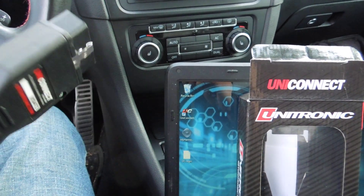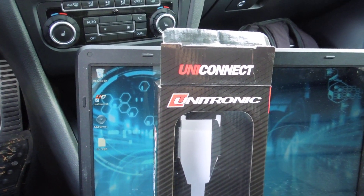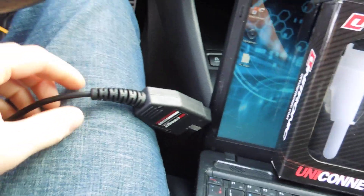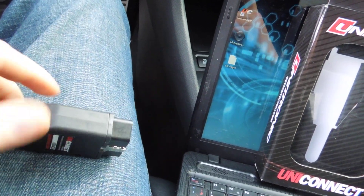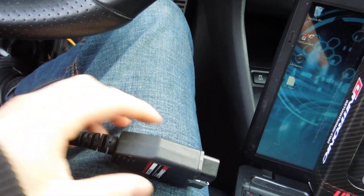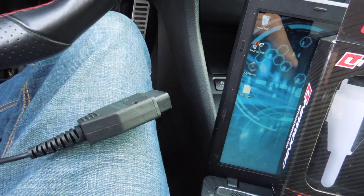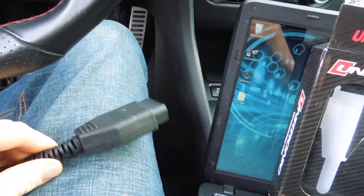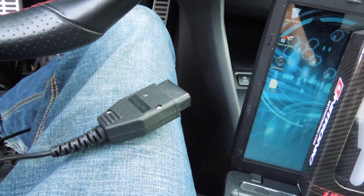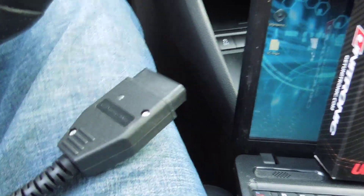Let's go into what you're going to need to do if you want to flash your car. First thing is a lot of people are going to buy this cable and say 'now I don't have to go get it flashed.' But it's a really good thing — before you buy this cable or if you're buying it through an authorized Unitronic dealer like I did through PG Performance — to ask first if you need a boot pin flash for your first stage one. A lot of times you will need a boot pin flash to get out of stock, and that's just how our ECUs work for this software.